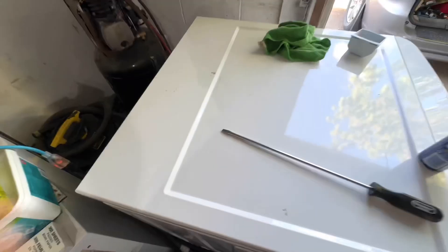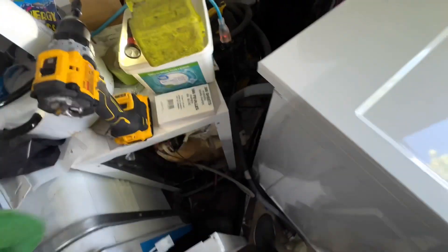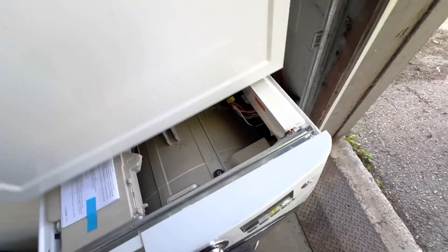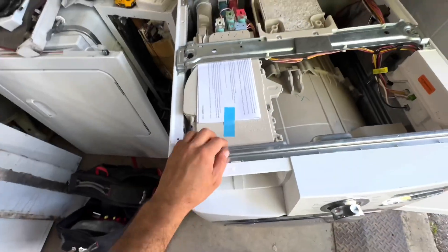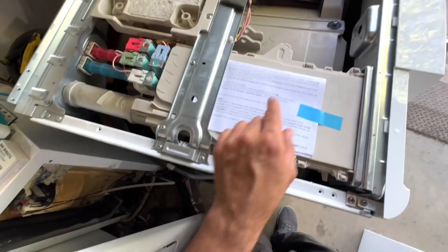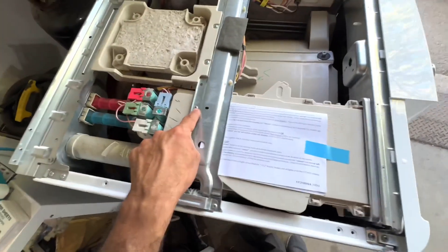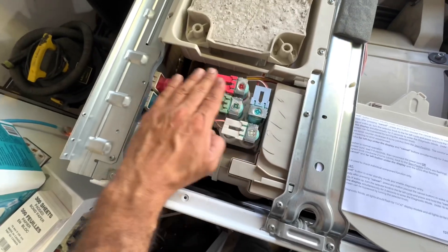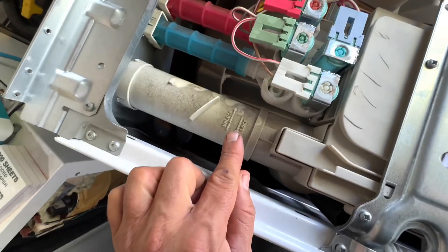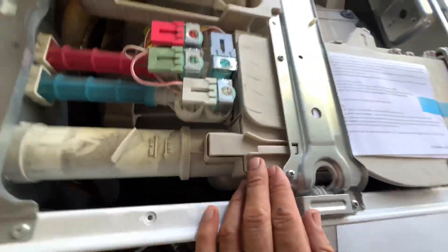If you're still having issues, the next step is to open the two screws on the back — one screw here and one there — and that pushes back the top panel. This is your dispenser assembly where the water valves are connected. You only need to replace this part. Open these two screws from the plastic, and the water valves will come out. There are also water lines here you'll need to disconnect — you push, turn to lock and unlock, then pull it out. Replace this assembly and that will take care of the problem.